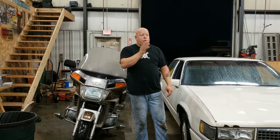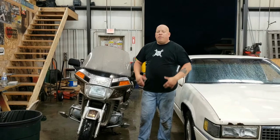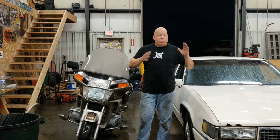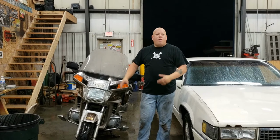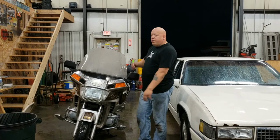So if you literally just start your car, drive it to the deli a minute and a half down the street, shut it off, start it back up, drive to the house, and that's your typical commute, you'll need a muffler inside of 2 years. If you start it, drive it a good distance, and avoid those quick little starts and stops, you'll have a muffler last you 200,000 miles. Your choice. That's why I let them run.